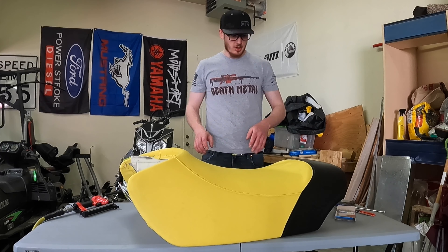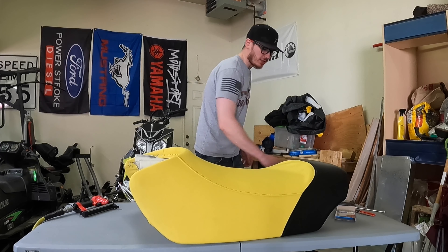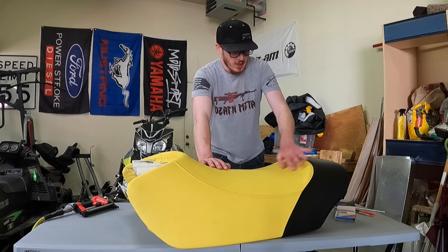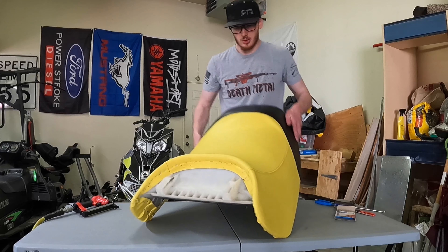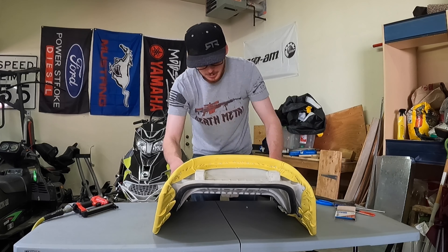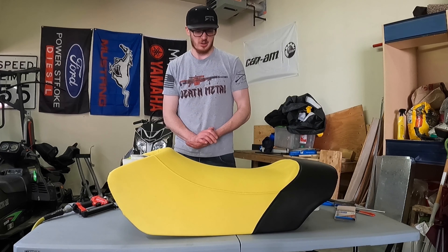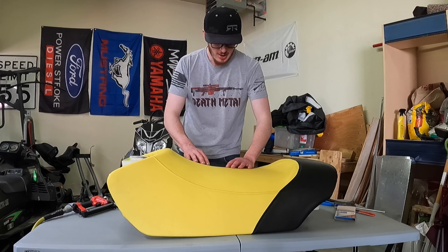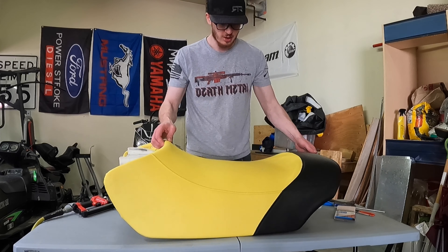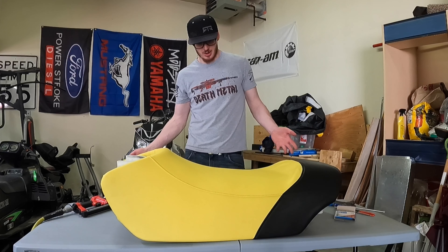All right guys, and that is going to do it for the front seat as well. I'm probably not going to put the whole footage of everything in here because it's pretty lengthy and boring, but I did end up having to take this off a couple times — I ended up screwing up where I was starting. You really have to make sure you get the whole fabric as centered as you can and start by tacking it here with just a couple staples, then work your way back. Really stretch it — you almost want to work it like you're putting vinyl wrap on a car, working out air bubbles and pushing them toward the edges, pulling it tighter and tighter as you work your way across. This still isn't perfect but I'm not too disappointed with it for my first time.